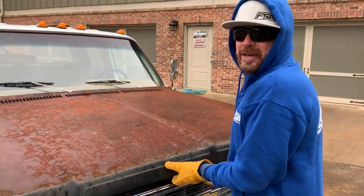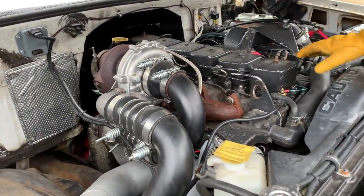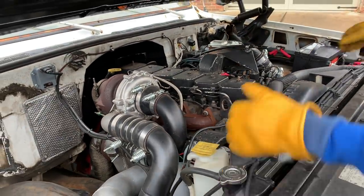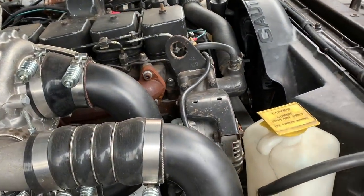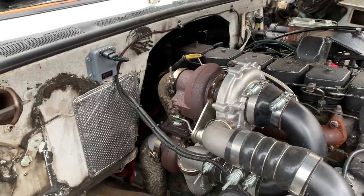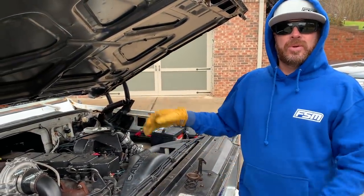I've already made some episodes about this thing, but here's the lowdown. That's a 12-valve Cummins — awesome motor in stock form, but we didn't leave it stock. We took the head off, O-ringed the block, replaced the head gasket, added compound BorgWarner turbos, and swapped the stock cooling system and intercooler out of a 1997 Dodge Ram into the nose of my square body Chevy. Doing so meant pushing the motor back, which meant cutting a massive hole in the firewall and in the floorboards for that transmission.